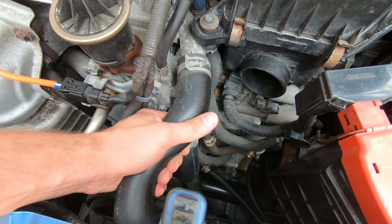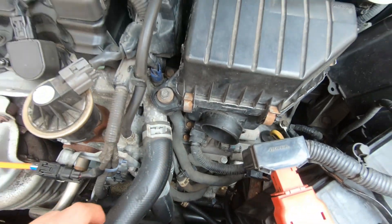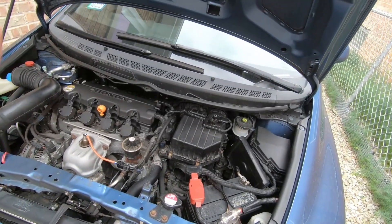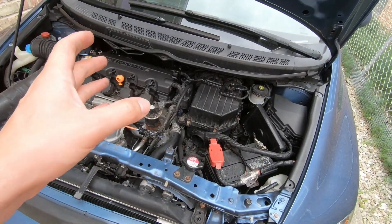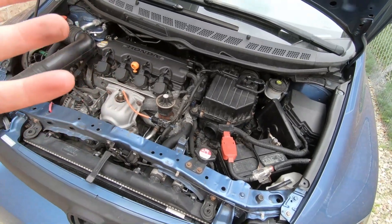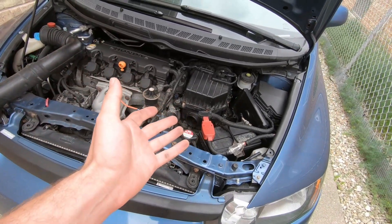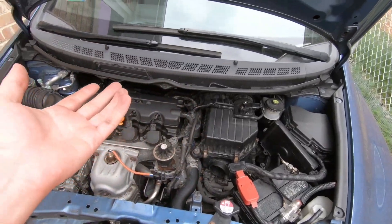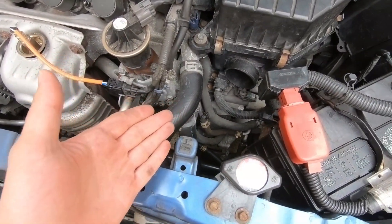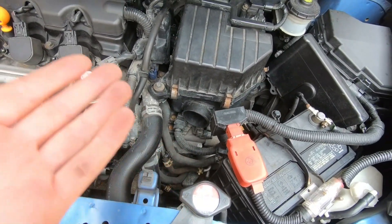As you can see, we've got the coolant hose right here and it's just radiating a lot of heat going right into the intake. Increased air temperatures means less oxygen in the air going into the engine, therefore less horsepower. It also means your air-fuel ratios will run richer, and the hotter the intake air temperatures are, the more likely the engine is to knock. I've experienced all those things — more knocking especially at higher RPMs and way lower air-fuel ratios.